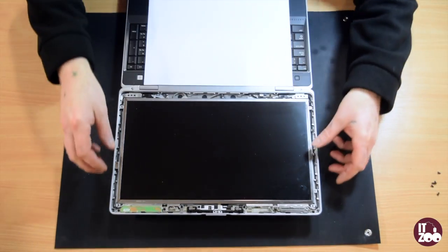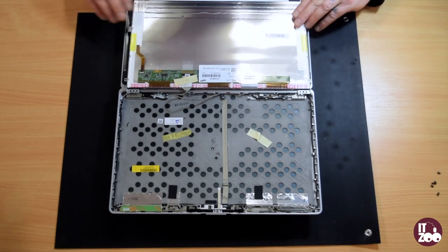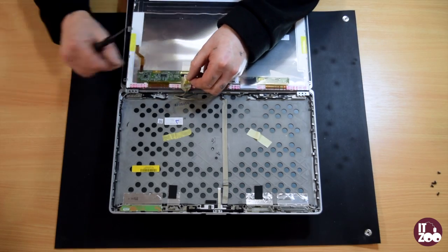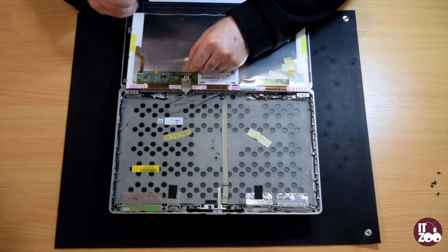Place a piece of paper onto the laptop keyboard, then carefully pull the screen forward and place it gently on the laptop keyboard. The cable connecting the screen to the laptop will be held in place with sticky tape — gently pull this away. Once the tape is removed, the cable can be disconnected from the screen.